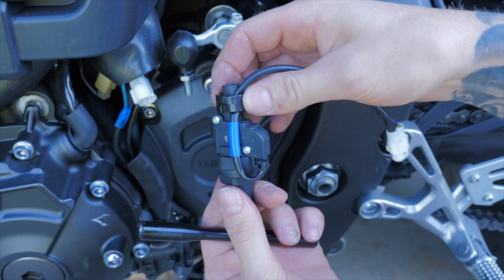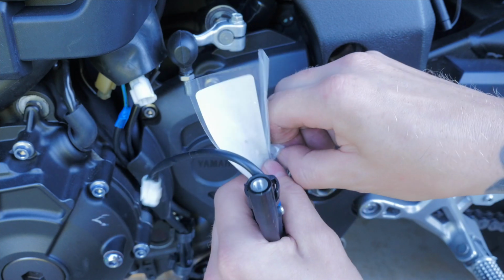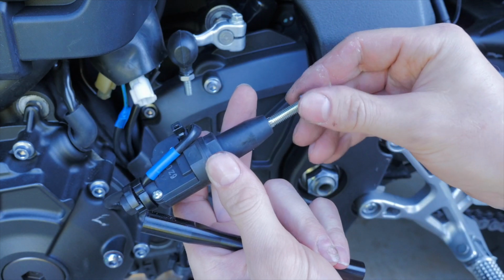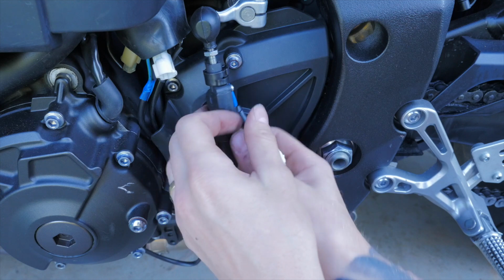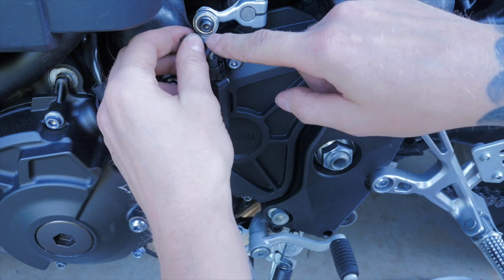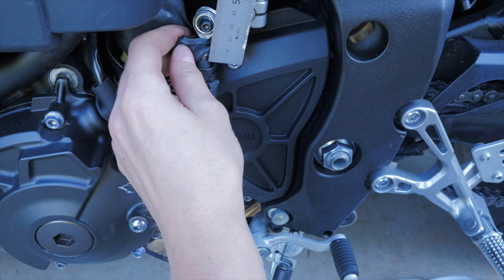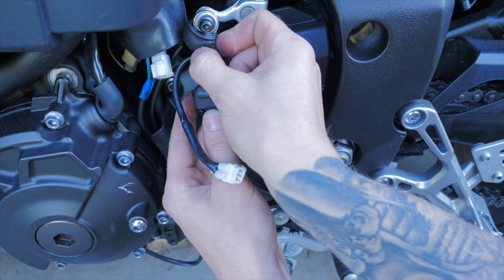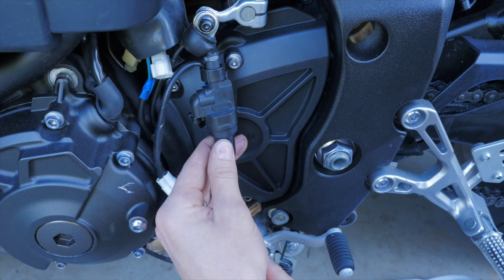So once you've got that plastic clip on the back of your Quickshifter, the next thing to do is to get the nut out of the packet. Install the nut on the end of the Quickshifter. So the instructions say the bottom of the nut is to be 27.4mm to the center of the bolt there. It could come down a bit further. And that's pretty close. And now to install the bottom one.